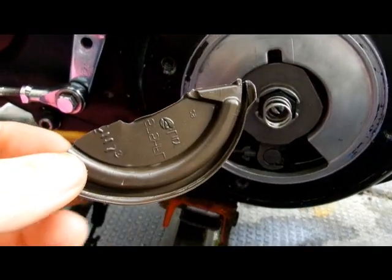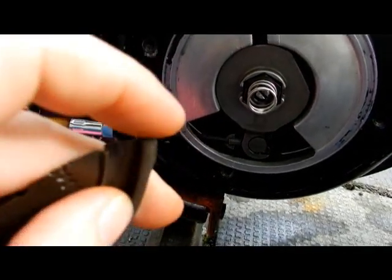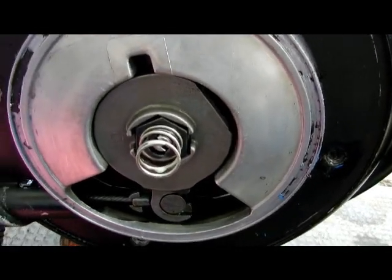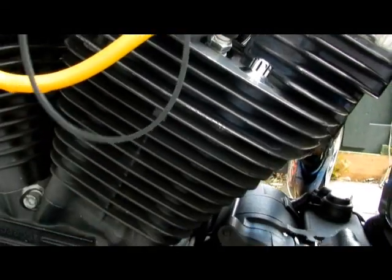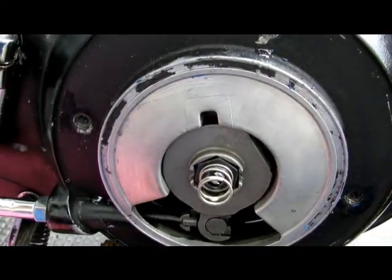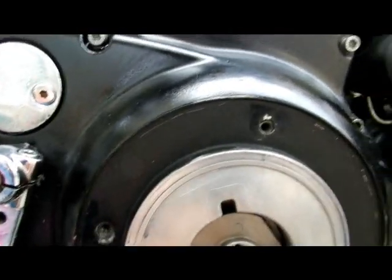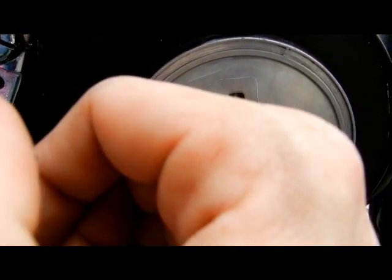Hopefully it'll focus here — check that out. So anyway, we're taking our time using the coffee lid to get this little groove here. It's pretty sturdy, you can put pressure on it and it will not scratch. Look how nice and clean I'm getting it, and then I'm going to throw a fresh gasket in with some chapstick to help it stick since I've got no grease. Nice and clean — no blue left, no black left anywhere.